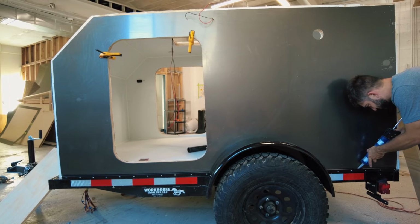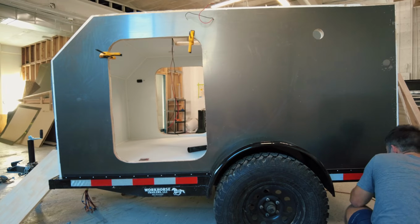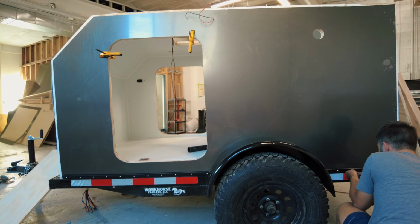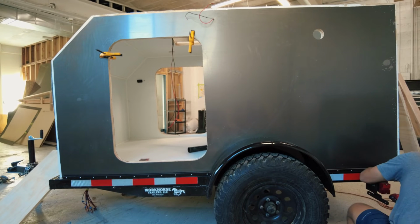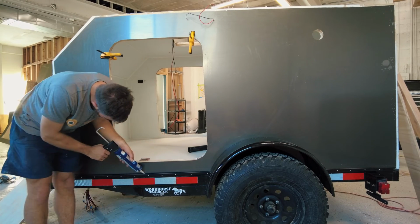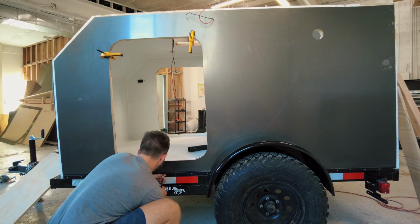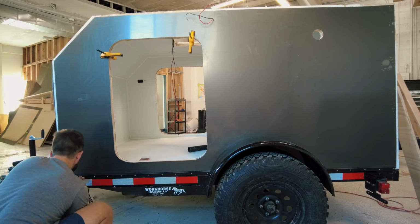To keep water out, I add silicone between the aluminum sheet and the trim before tightening down my trim screws, but I make sure those screws aren't overly tight. Doing this allows just enough wiggle room for the aluminum to expand, while also keeping out any water from the rain and snow. I only do this on the bottom trim and the trim on the roof.